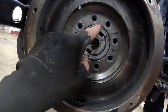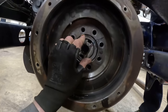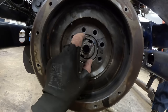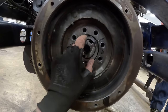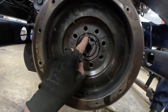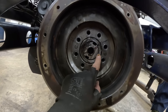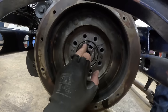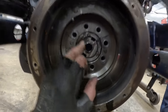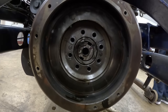When I said we put the big nut, see, that's a great big nut that holds the thrust on normally. But we held our boss on, well, we shrunk the boss on, but that keeps it in place. And then to keep that from undoing, we just put that little bit of weld there, which is a bit bodgified, but it means it ain't going to come loose. And if we had to take it off, we'd have to machine that boss off, because we got it really hot.